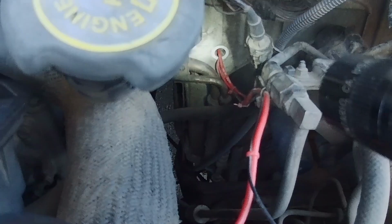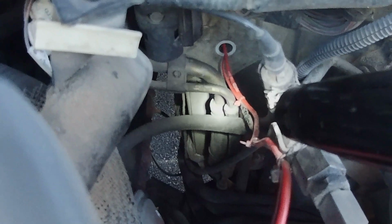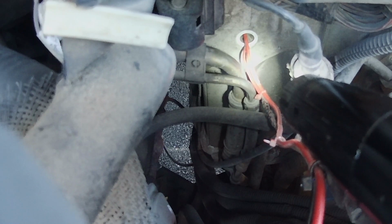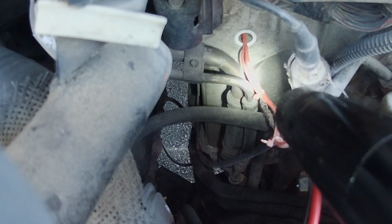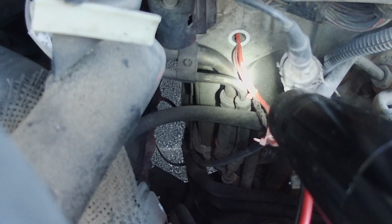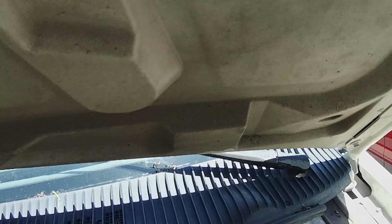There it is right there. It's a good size hole, probably 3/4 of an inch in diameter, plenty of room. What I did notice, you can see my wires right there. If I'm not mistaken, those sure look like chew marks. That insulation, that's the horn wire. Maybe I did that when I was pulling it through, but gosh, I wouldn't have left something looking like that, and it kind of looks like little teeth marks. I've been all over under the hood here, and I don't find one other wire that's chewed. They wanted that horn wire. So I'm gonna tape that up while I'm working on this project, just to get that covered. Again, that's the wire for the horns.